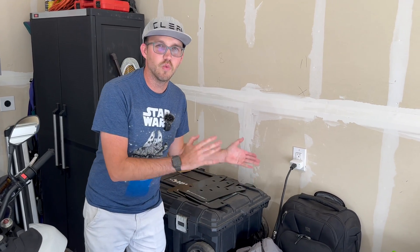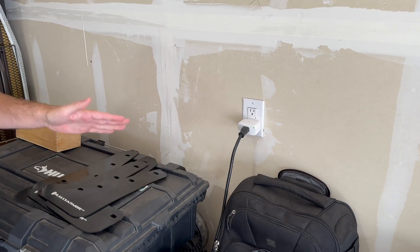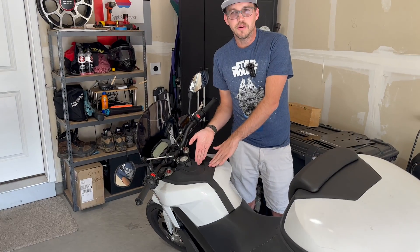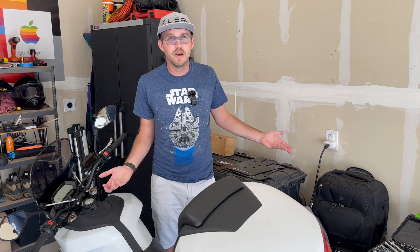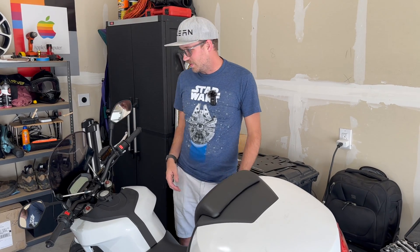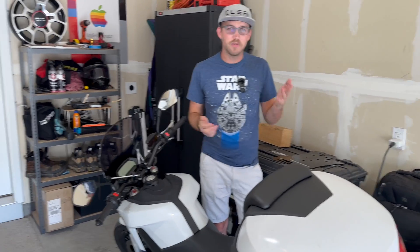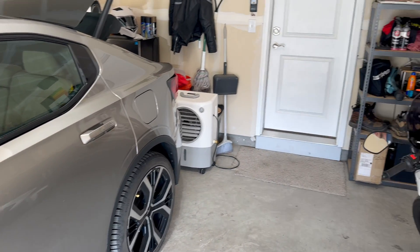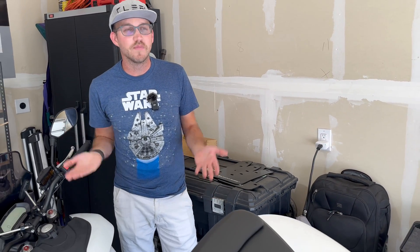This is all about what we call Level 1. In typical American fashion, this will do up to about one to one-and-a-half kilowatts of charging speed. For a bike like this — just over 14 kilowatt hours — that's around 10 hours to charge. You can think about it simply: at 1 kilowatt charging speed, in 10 hours you get 10 kilowatt hours of energy. So this bike on a Level 1 outlet goes zero to full overnight. But on a car, it's what we consider a trickle charge — it charges much slower because of how small a percentage of the battery that 10 kilowatt hours represents. On a car overnight, this might only add 10 or 15%.